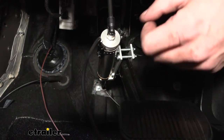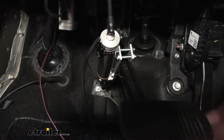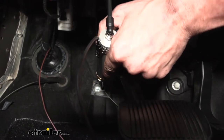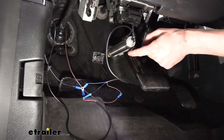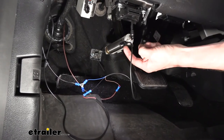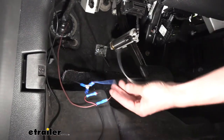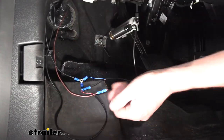We also want to check the play once it's secured - make sure your pedal is not being pulled, we don't want the pedal applied all the time. Check your cylinder by pulling on the pedal towards you making sure it has a little movement, and pull the cylinder towards you as well - just make sure it's got a little bit of play on your pedal. Once you've got that mounted, you have a reed switch that comes in the same bag as your cylinder. Slide the reed switch into the little slot and use a very small flat screwdriver to tighten it down. This will have three wires coming off it that we'll hook up in a minute to actuate the indicator light.